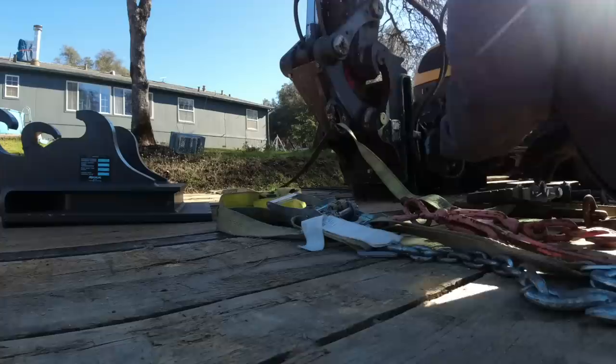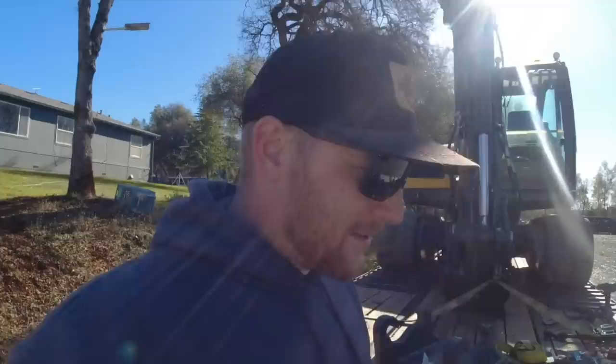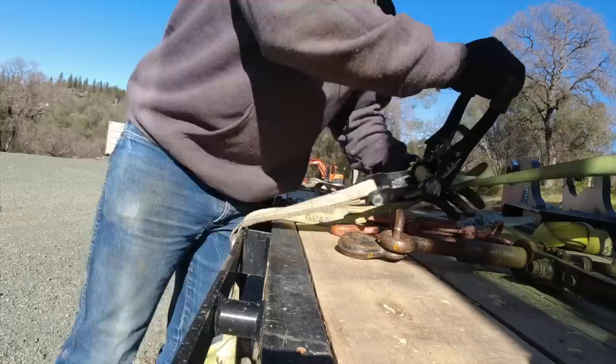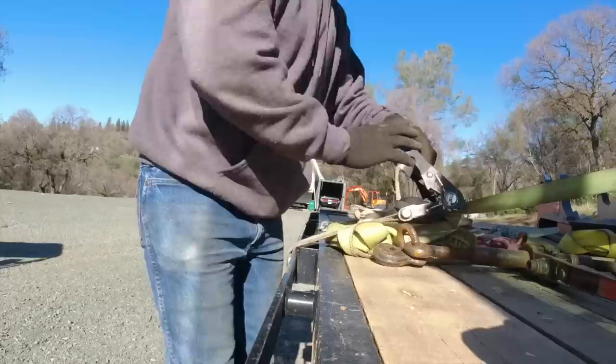Let me show you what I actually do with it. Nice, simple, dirty - this one's got a hook. Put it right there in the stake pocket. Now, oddly enough, a little bit of controversy people bring to the table whenever showing tying stuff down is you can't have it on the outside - that puts you at over width, you need an over-wide sign or something. Word on the street is if it's your binders, you're exempt from the slight over 102. Take this guy here, give it a couple pumps, slide your excess underneath there. Done - that's all that needs to keep it legit.